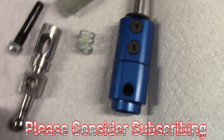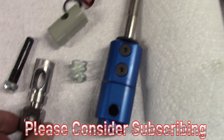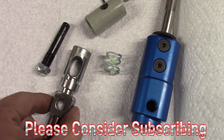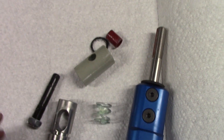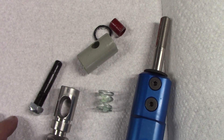I basically modified an MT-82 handle from MGW, and welded it to the base from a Camaro shifter. If that sounds crazy, watch and you'll see how it was done. Here's the MGW MT-82 shifter handle taken apart — it incorporates a push-down reverse lockout mechanism. It really made sense just to buy this versus trying to engineer something myself.